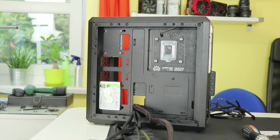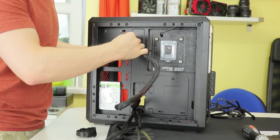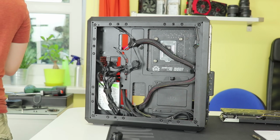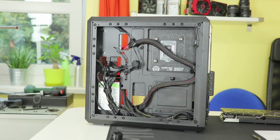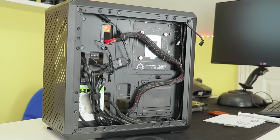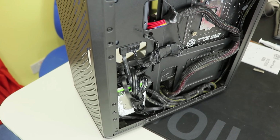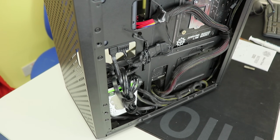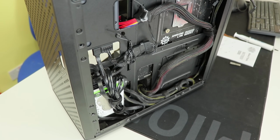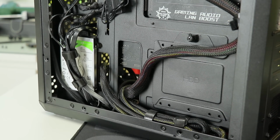I thought it would be a good idea to skip past the back and forth cable management process, but it has to be said I don't think this could have been made any easier. The sheer amount and size of the cable management loops allows the largest of Velcro straps to be used, and the huge almost 30mm depth behind the motherboard tray meant I could bundle and strap excess cables together without issue. And the positioning of the 2.5-inch drives with the previously mentioned points meant that I only needed to use one SATA power cable to provide power to all the drives.